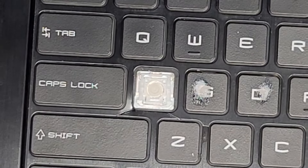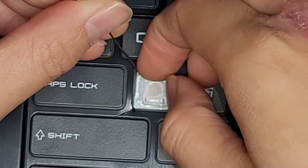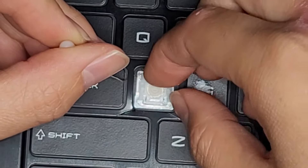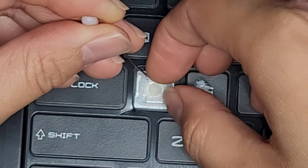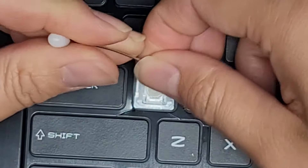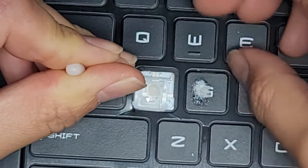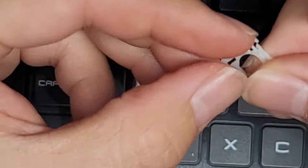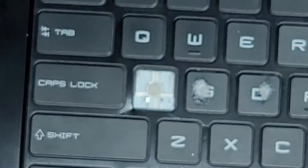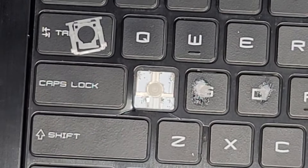I'm going to use a bent needle to get these out. This one doesn't look broken — let's pop it out anyways. I don't know where the A key went because I remember it was in the computer. So this one is broken — you can see this hinge is cracked and separating. It shouldn't be like that, so we're going to replace it. You can see which way the hinge goes.